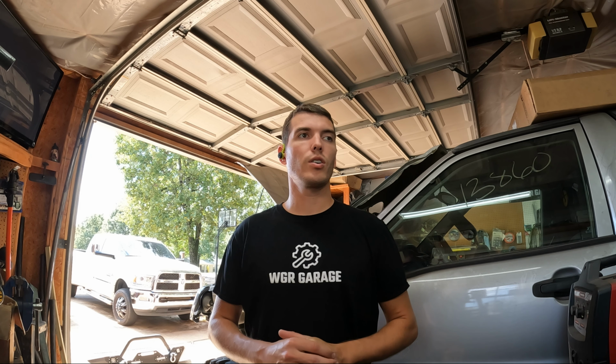Okay, it's a new day out here, and we got an awesome head start on that four link yesterday. So where I left off yesterday was that I got the chassis side lower tabs tack welded in. Now I need the tabs on the axle side to be cut out on the CNC, and then tack welded in place, so we can start measuring for our links. That is what's next. That's what I need to work on. So let's get started.